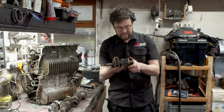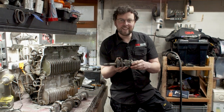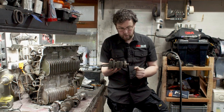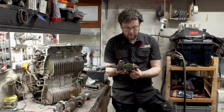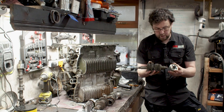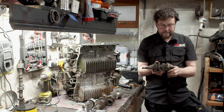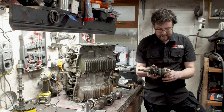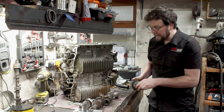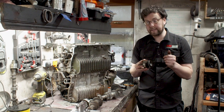When the splines are lined up and you put the car in gear, the selector grabs hold of the dog ring and slides it forward — it either engages the gear or abuts the gear depending on position. Once in gear, there's a lot of play — and that's intentional. Within half a turn it needs to go into gear. Without that play, it would be like when the balk rings start to fail on your synchromesh gear, where you hear that grinding sound as you try to select.